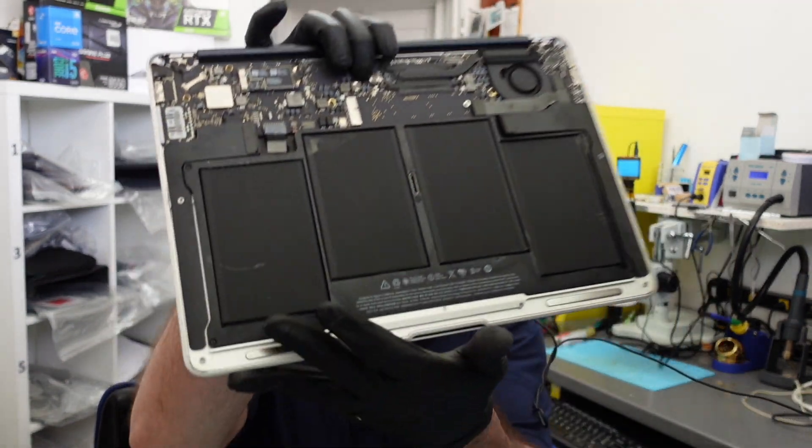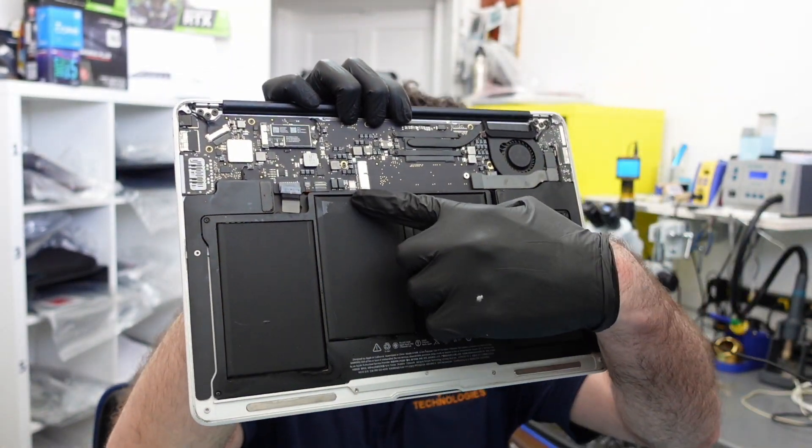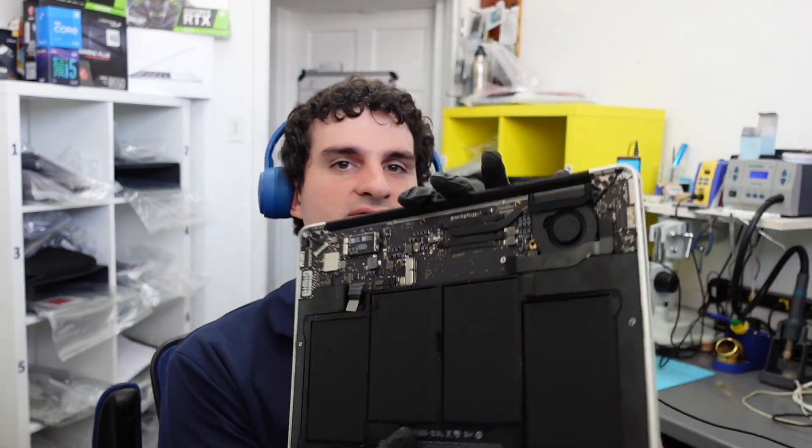All of a sudden they put it in their bag, went to turn it on, and it was just dead. I did take a look at it — I have it open here — and I noticed some liquid around the battery area. There's liquid damage and it's not powering on at all. I let the client know about it; they weren't aware. I don't know if it corroded more over time or just got worse, but that's why we're opening it up further today.